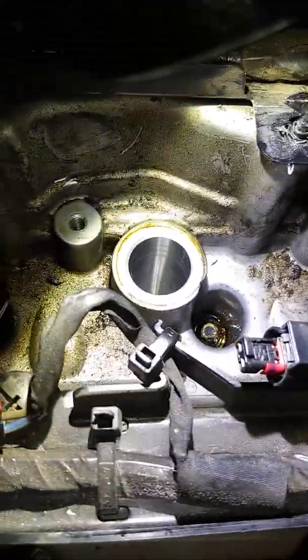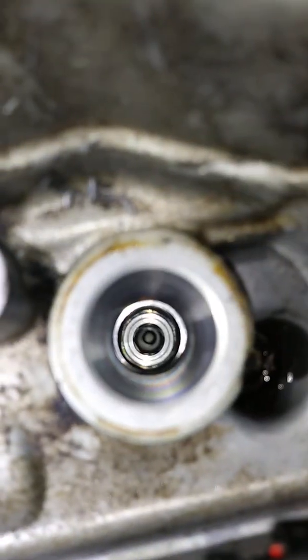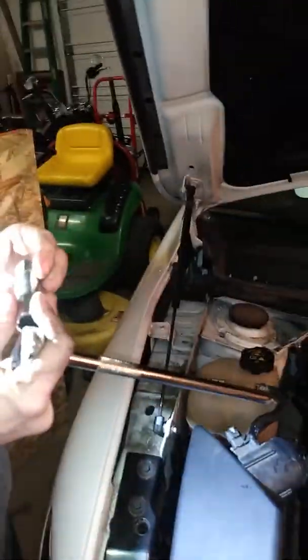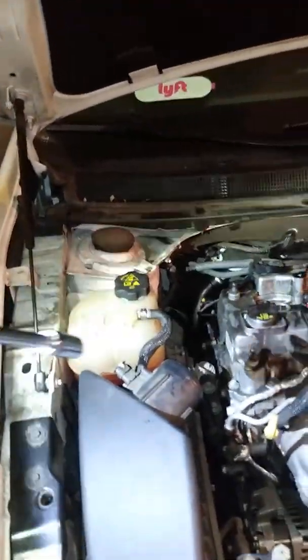Okay, let's see. There was a bolt down there that I don't have any business dealing with, but there's something down there that shouldn't be covered in that grossness. So what we'll do is just pause the video again. I know it's a lot of pausing, but we're going to come back when all these are off. Sorry about the pausing — that stuff was a pain. We've taken all the housings off. I've looked in here — this one was filled with some motor oil, this one has some little fuzzy inside but that shouldn't be a problem. I cleaned as much of this as I can out. These two are perfectly fine. So what I'm going to do now is change this head. So with a little bit of force, this should come off. And then I'm going to put the spark plug puller — this is a 5/8ths Husky spark plug puller attached to my extension, because you have to get down in there. I have no clue what these are going to look like when I pull them out, but we'll find out.